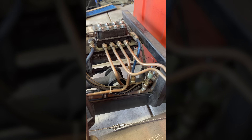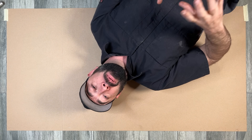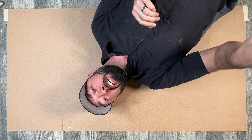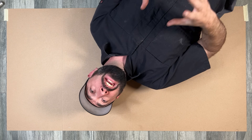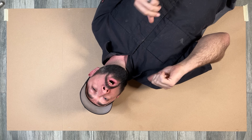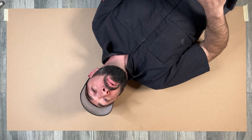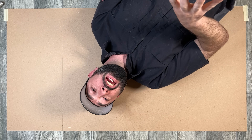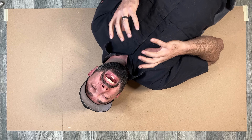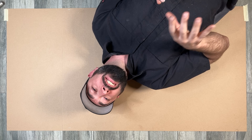Keith gets to do all the fun work of taking everything apart. My personal goal for this project is to make the least amount of trips possible from my house to Keith's house, 20 miles away. I'm going to do that by bringing his truck here to my living room floor. I took a handful of measurements from his garage that will help me draw a section of his frame actual size on cardstock. Once I have his frame with me, I should be able to design the majority of his link bar setup, including link bar length and the link bar tabs for both the frame and the axle. And once that's done, I will have actual size templates that I can cut out and transfer to steel. If everything works out as planned, I'll be able to assemble his entire link bar setup here, bring the assemblies to his house, and simply weld them on.